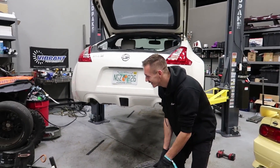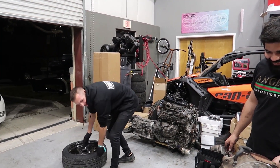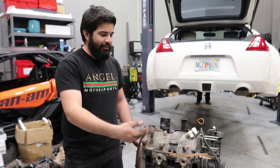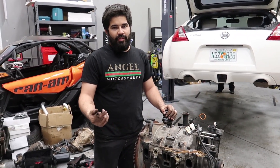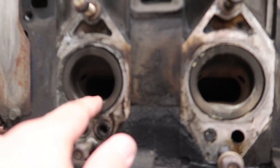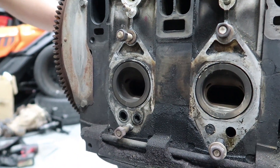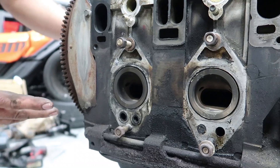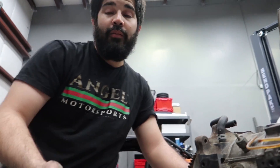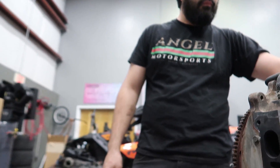So it's like a six-cylinder and I've got a four-banger on this — I thought I had a round six! Once we take it apart we'll find out what's going on. It could be an apex seal or a side seal issue. I actually pressed all the apex seals on a cushion and they all spring back, so they're probably okay. It could be a side seal issue, carbon locked, or a chipped apex seal. It looks like something's wrong on one rotor and something's wrong on the other — possibly side seals from sitting.